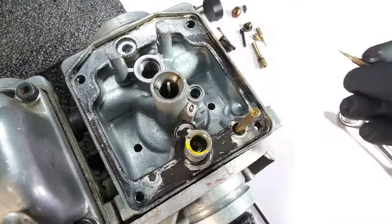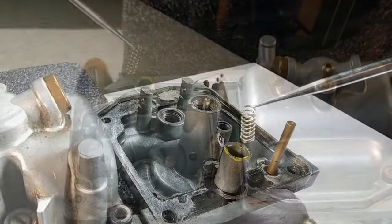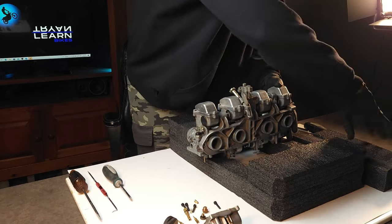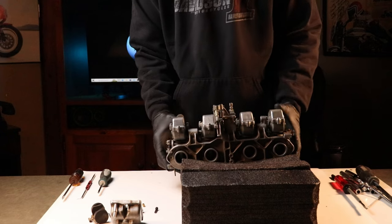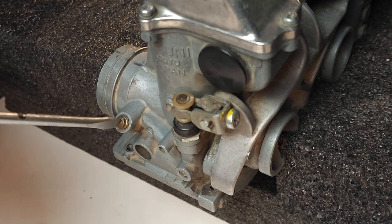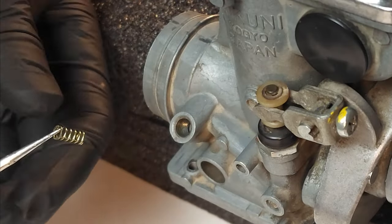Now this is the monkey that's gonna cause you trouble — that's the pilot jet, and guaranteed that thing is gonna be clogged up if your bike's running crappy. Nine times out of ten, it's that culprit. This carb has a fuel screw, factory set at two and a half turns out from buried all the way in — remember that. There's a spring in there, get that out, and there might be a little washer or grommet underneath. Now for the air screw — same idea, set at one and a half turns to bottom out. Remember that.